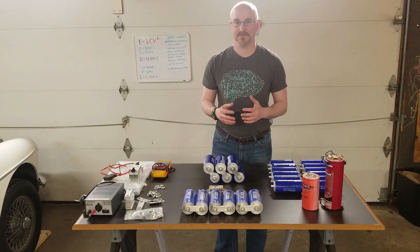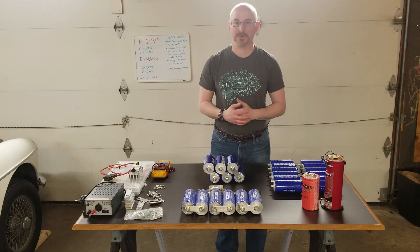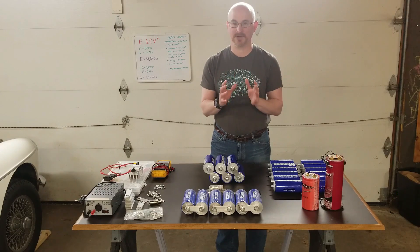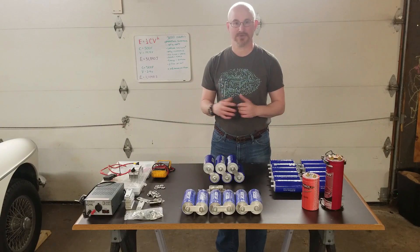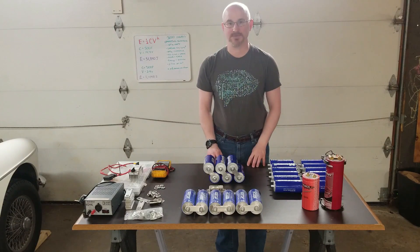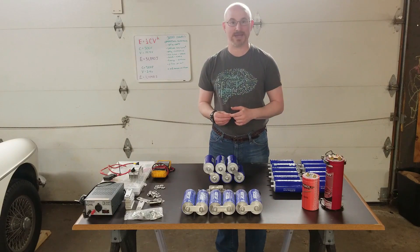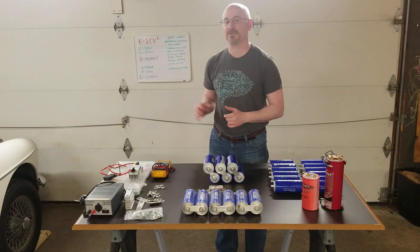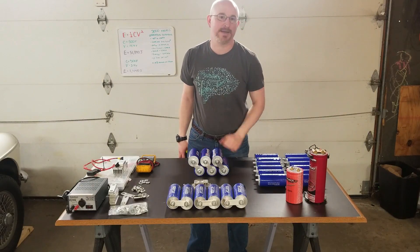If your system has the ability to draw high amounts of current sustained for long periods while your car is running, a high output alternator is probably recommended. Make sure that alternator delivers enough current to run the entire vehicle and system to maintain 14 volts or greater throughout. Capacitors behave at whatever voltage you set — 14 volts or 12.5 to 12.8 volts float voltage of a battery, no problem. They will extend battery life, extend alternator life, and reduce voltage sags at the amplifier.